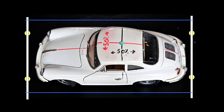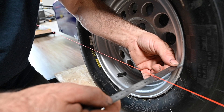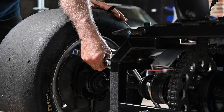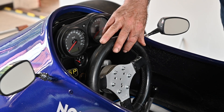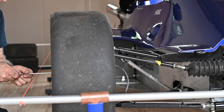Now that the wire frame is fully parallel to the car, we can start adjusting the toe. Select one wheel — the left rear — and measure the distance between the front of the rim, at its middle, towards the string. Then measure the same thing at the back of that rim towards the string. If A is bigger than B, you have toe in. I'm going to set mine to about 1.5 millimeters, so A will be 1.5 mm larger than B. Adjust the toe rod, then do the same on the right rear wheel. For the front, set the steering wheel to its center position and lock it before measuring.